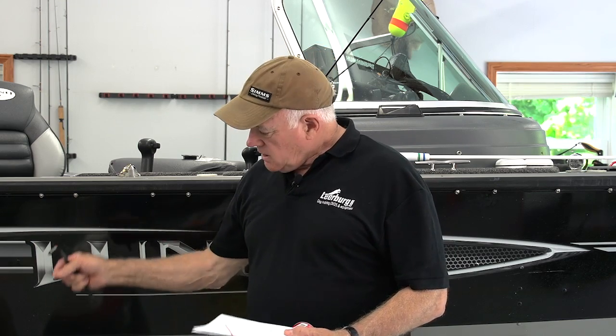In our case, we have to take the calipers off the wheel, and we had to have a 3/8 inch wrench to take those calipers off. It didn't work with a socket because there wasn't enough room, so we had to have this wrench. We also have a box of cotter keys because you're going to wreck a cotter key when you take the nut off the axle. So have different cotter keys there so you can replace it and you're not running around looking for another cotter key.